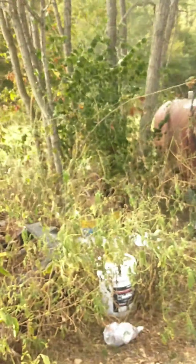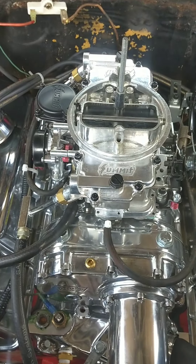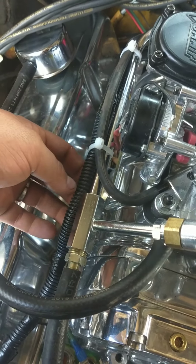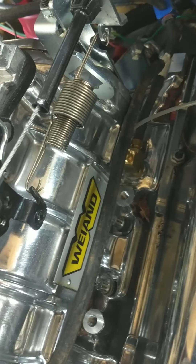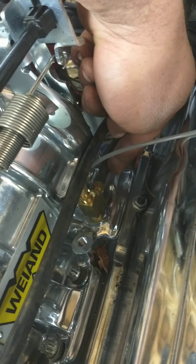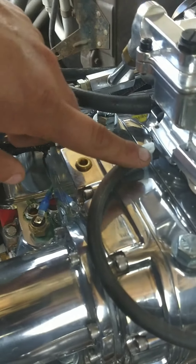So if you can hear me over the wind — cause it is blowing pretty good — got it all back together. Got our vacuum lines reattached. These zip ties are just to support the wiring harness because I don't want it hanging off of our choke wire. And then this is our boost reference line, zip-tied on because it's a dead end — it's just going to blow into there, so I don't want it to blow off. So here is our boost gauge pressure.